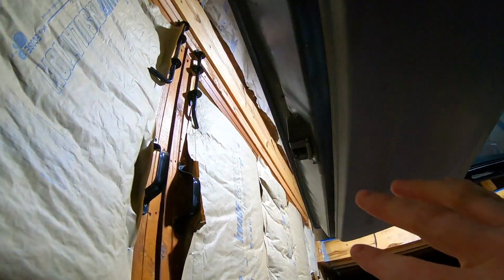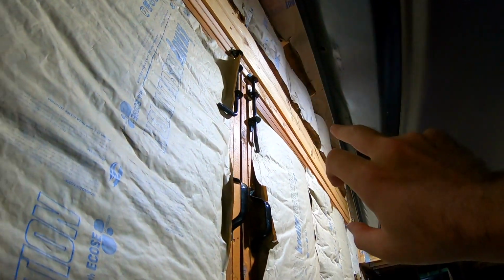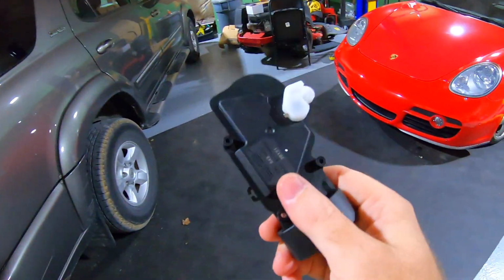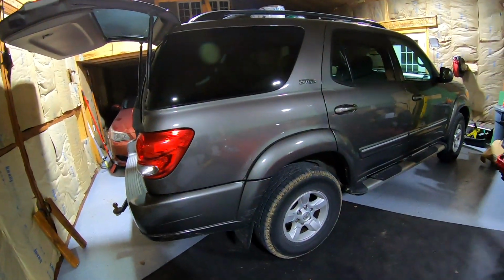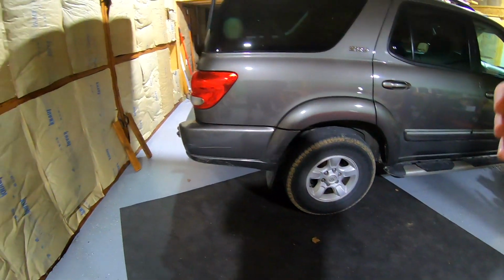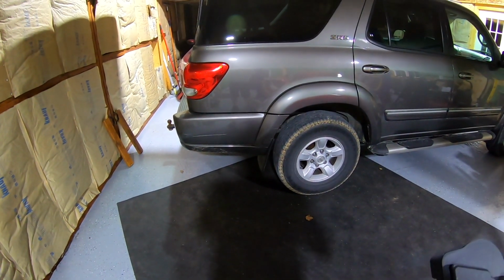So you have the latch that goes, a cable goes from the latch up to the handle. But on top of the latch, this actuator mounts. So when Kevin bought an actuator, he bought the Chinese one. Well, as soon as it rained, guess what? It stopped working. So it locked, wouldn't unlock. Actually, I had stuff in the back I couldn't get out. It was inconvenient as hell.